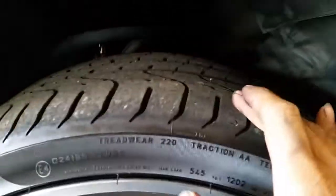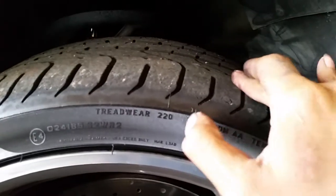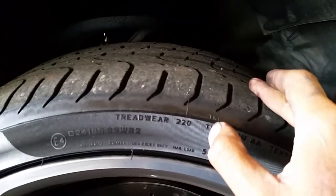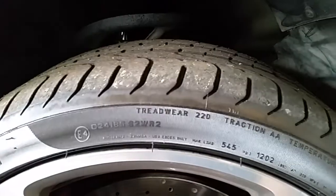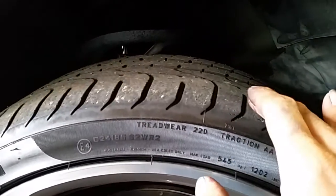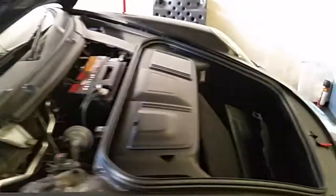The only thing I found was the right-hand side tire was at 24 PSI. At that pressure you get excessive tire noise, and it sounded like a noise from the front suspension — but really the tire was just too low on air. I pumped up the front tire and the noise went away.